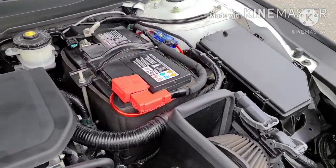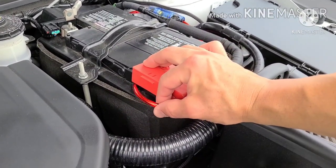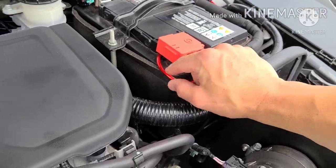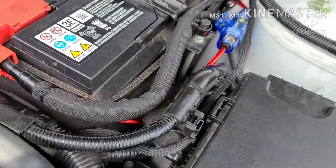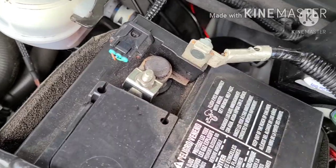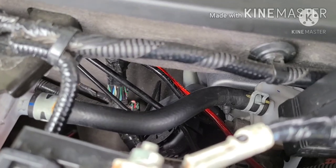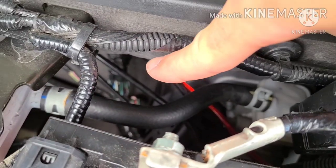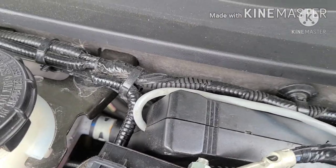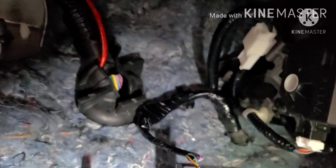Here's how it looks at the battery area. I could have cut this but I decided against it. This kit only requires an 8-gauge wire, which is actually fairly small — it's only a 400-watt RMS amp. 8-gauge wire is pretty easy to run and small. I just ran it around the battery there, a little wire tie here for the fuse, then moved my JB4 out of the way. There's a boot right where you see those thick stacked wires — I was able to just make a little cut. I didn't even have to drill any holes, and I ran the wire through.